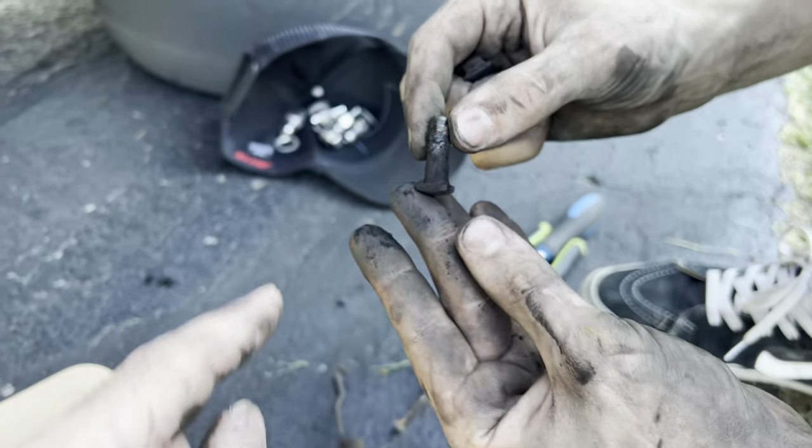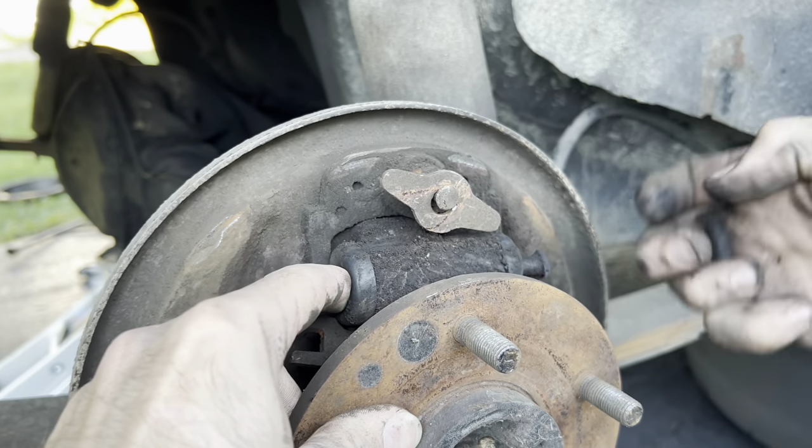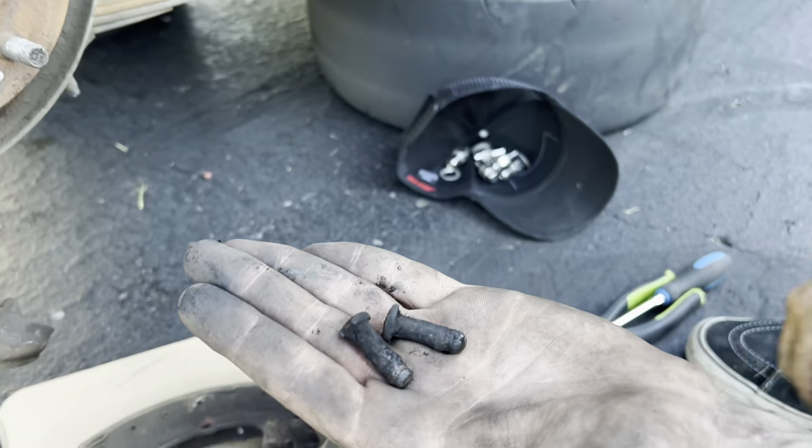These tabs that used to push off of the shoe into the wheel cylinder itself — make sure you save those just in case the hardware kit you have doesn't come with new ones, because I found that they usually don't.